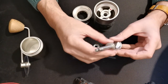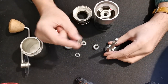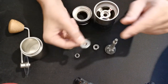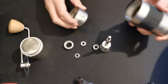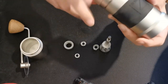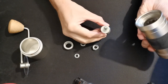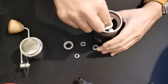Now we're going to put the grinder together. Bottom burr, then the spring with the smaller side down and the widest side up. Then the bottom bearing shield with the dish side up and flat side down. Then the body of the grinder — reverse thread — screw the bottom burr onto the body of the grinder and tighten it as tight as you can. Place the bottom burr through the bearing at the bottom.